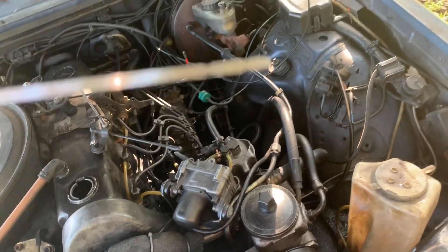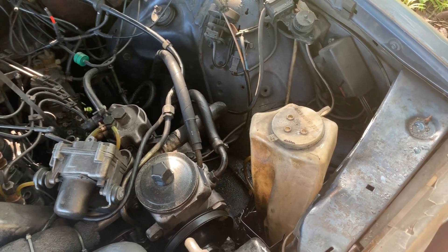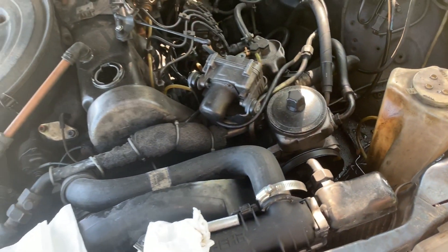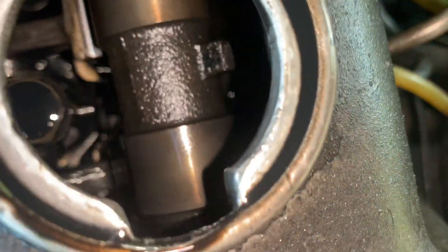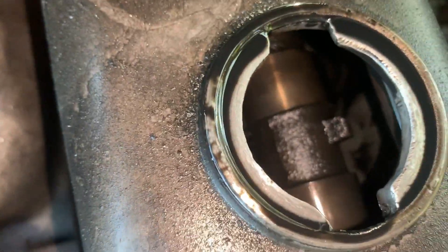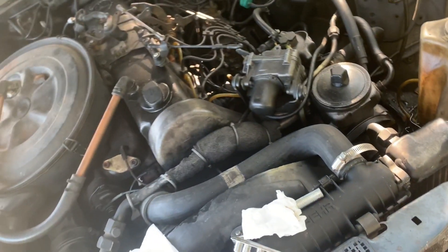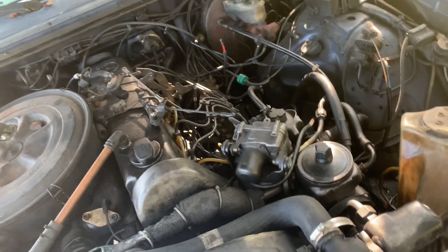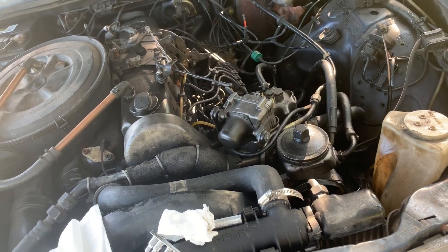Let's check — nothing touches. When that thing blew off, this engine pumps a lot of oil and I'm sure it was just a garden hose stream of oil. Let's look at the camshaft and see if there's any scoring. I do not see any scoring. It still looks a little oily, not too bad — that's a good sign. I just did an oil change a couple hundred miles ago.